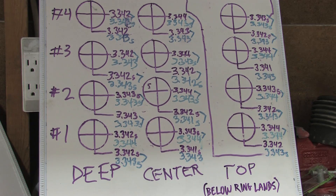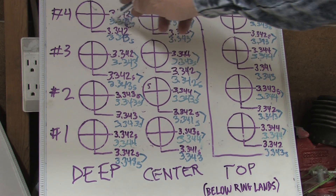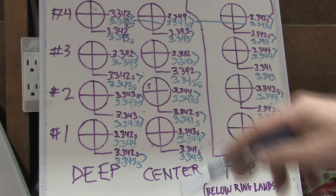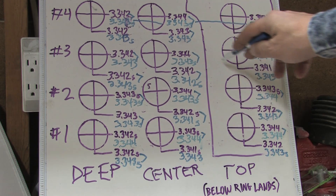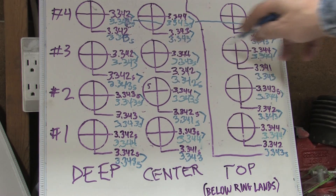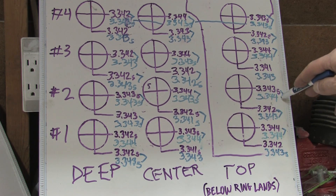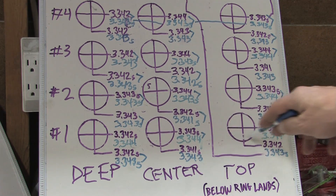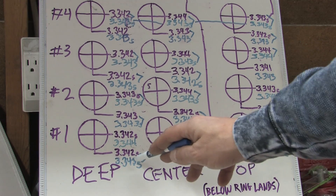When checking for taper, pay attention to how the thrust-angle measurements through each bore's depths interact with each other. Number four is perfectly parallel through its whole bore. Number three has a thousandth of an inch taper from bottom to top, so it's about twice the service limit specification. Number two seems to flare a half-thousandth at the top, but it's probably still within spec since we're measuring in half-thousandths. Number one is also perfectly straight, so I have significant taper in only one bore — meaning number three's compression numbers were likely a little lower than the rest.